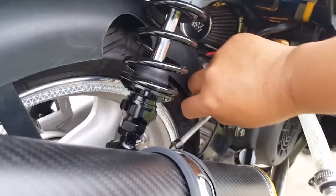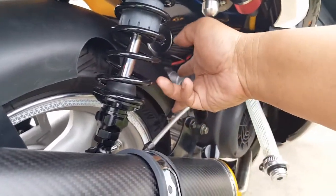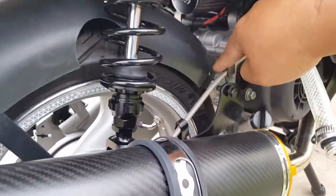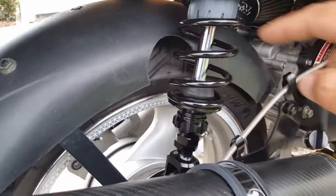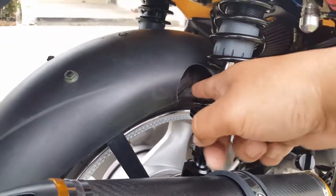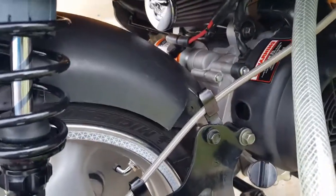And we'll see how this guy drives with this on there. I'll go slowly around the block and see if he's creating a problem rubbing or so forth. If he is, then my solution would be just to cut that lip off, like something like this, but not that dramatic. We want most of whatever is picking up the dirt here when it swings over to be able to capture it before it goes into our air filter. That's the idea of capturing that.